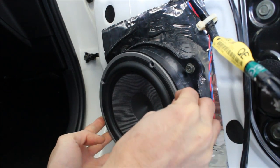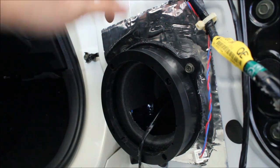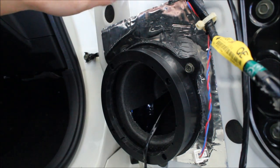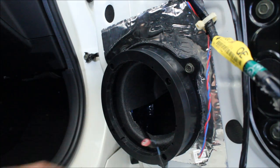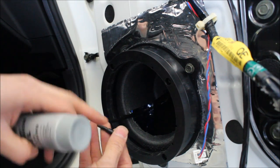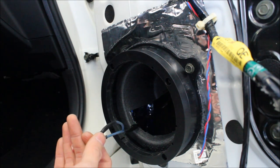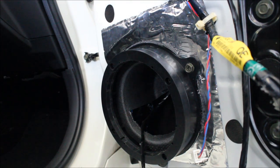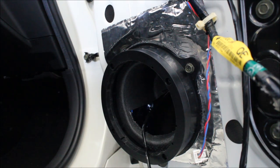Now we're double-checking for clearance — we can feel that we're not touching anything, so we're ready to put the speaker in. I ran the woofer wiring through a grommet up top and looped it around the inside wiring to keep it away from the window. On my spade connectors, before I crimped them, I put a little bit of dielectric grease inside the spade, crimped it, and put shrink tube over it to get as good a weather-resistant connection as possible. You could put a very thin layer of dielectric grease in the connector as well. I see a lot of cars, especially older ones, where water might drip on the speaker — taking all these precautions means I won't have to go back and service the speaker again.